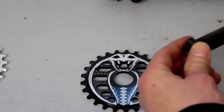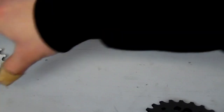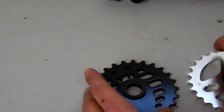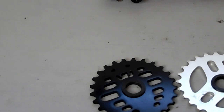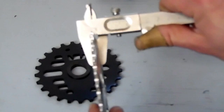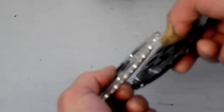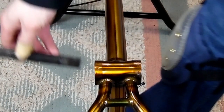Now if you're just doing a sprocket removal and installation, there's still one more thing you have to do: compare the thickness of the sprocket and the adapter to the old one. If your new sprocket is thinner than your old one, then you're going to need a spacer to take up that amount of space to make it even again. And if it's thicker, then you want to add a spacer to the other side just to make it even so your crank arms are the same distance away from your frame on each side.